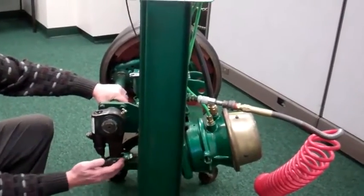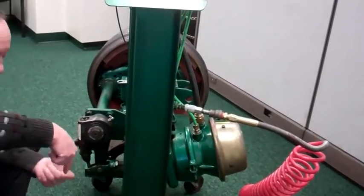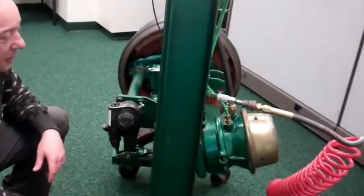The first thing you told me was: before hooking up to the trailer, with the brakes set, you can go back and check the brakes to see if they're out of adjustment. By checking that angle — if the brake chamber rod goes past a 90-degree angle, it's out of adjustment. Correct.